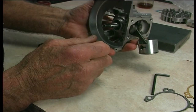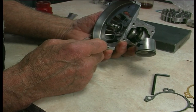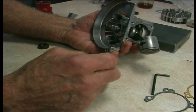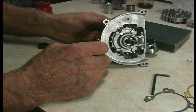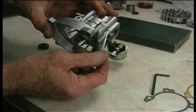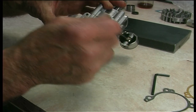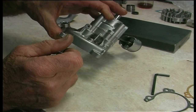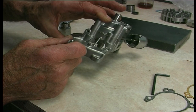We'll pull it apart again and put a bit of fresh sealer on there. In the trade we refer to it as 'red silly' — if you go into any auto supplier and ask for red silly, certainly over here they'll know what you're talking about. Red silly is what we use on exhausts — very high temperature capable. Just a very small, very thin amount because the paper gasket is now so thin we don't need a huge amount. As long as the housing is not warped, we should be right.